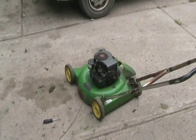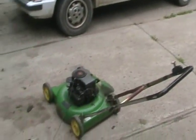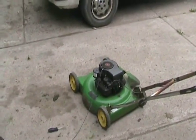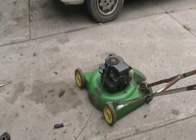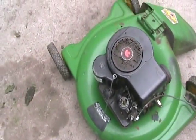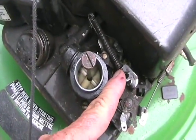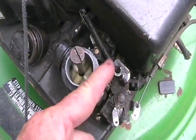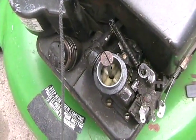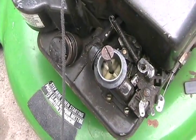While it's running, look for oil-burning smoke that doesn't clear up after a little bit, and listen for crank knock noises, so you can decide whether to keep this engine or scrap it. If you want to increase the speed your lawnmower runs at for more power, cut off a couple of winds on the governor spring and bend a new hook on it. The shorter the spring, the faster the motor will go — but please don't make it too short, or you could blow up your engine.